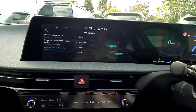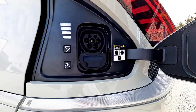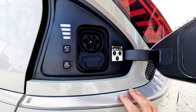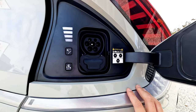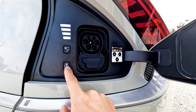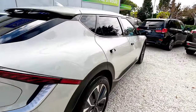About the exterior button underneath the charging port — many people don't know what it does. When you have scheduled charging set up, plugging in means the vehicle won't charge immediately. But if you want to start charging right away, press and hold this button for about two seconds and the vehicle will bypass the schedule and start charging immediately.